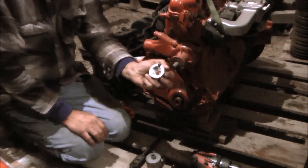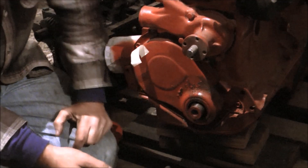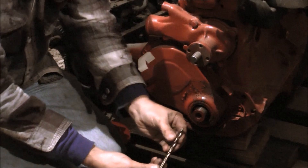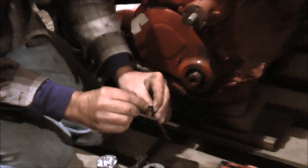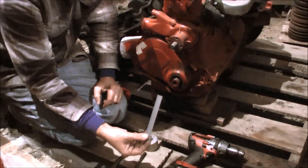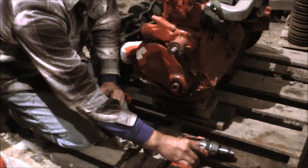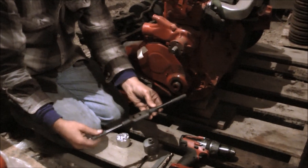So you're going to use a snout tool made by 12bolt.com, and the tools that you will need — I can provide those in a kit. You're going to need a 7/16ths-20 tap. You're going to need a W drill bit, also supplied in the kit. A nice double-edged drill bit. Something to measure with — it could be just a tape measure. You'll need a drill; I prefer a half-inch drill. You'll need safety glasses, and I use a tap driver myself.